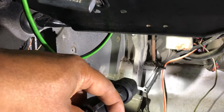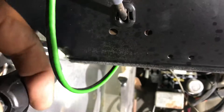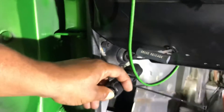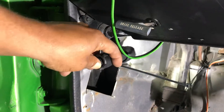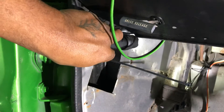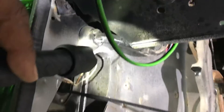I'll show you what I did. I took my air nibbler, I cut me a hole, I ran a two-foot zip tie through the door onto the door, put my speaker wires in there. I cut the hole good enough because if you're familiar with the C10, the plate - the seal plate here - is really flat, there's no room for wire. But the other side's got a spot for it, so you cut it up a pretty good size.